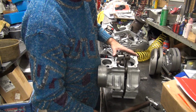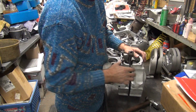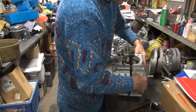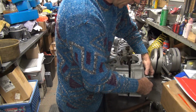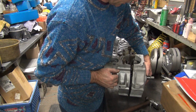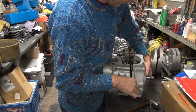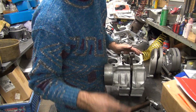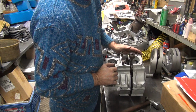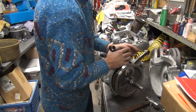So it looks like we're almost bottomed out with a 1/2 inch in there. So it moved over quite a bit more than I thought it was going to move. Of course, we don't have it exactly pulled in flush and tight like it would be if I actually installed it correctly. It's hard to feel where it's going to sit right now. Things aren't quite in there like they should be, obviously. So my guess is I'm one spacer too many in there. So we're going to pull out one of those spacers, see where that puts me at.